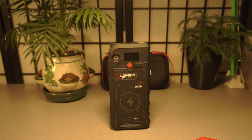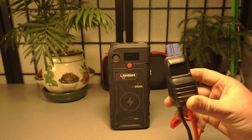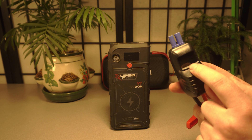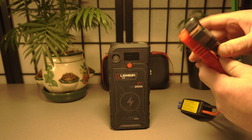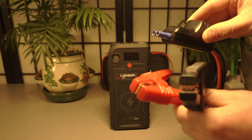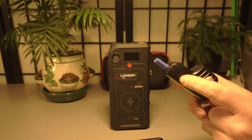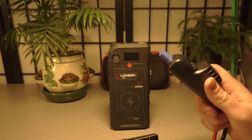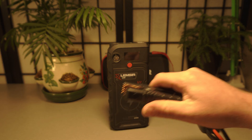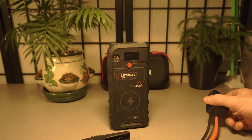The second portion of the video shows me starting up the boat. One key difference with this new device is that the jumper cables display the battery voltage — and you don't even need to plug them into the device. If you just connect them to a battery, it'll show the voltage, which is really useful on its own. The previous models didn't have this feature. Another difference is there's no longer a button to engage the capacitors before jump-starting. In my experience, simply disconnecting the negative and reconnecting it prepares the device for another jump, which I found easier.